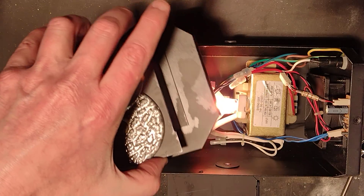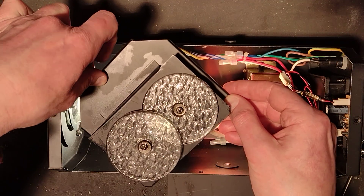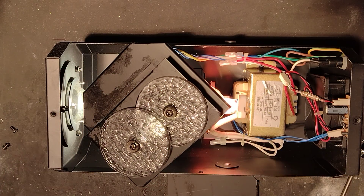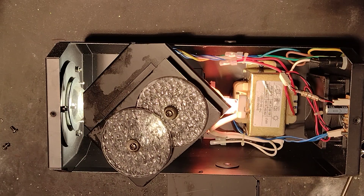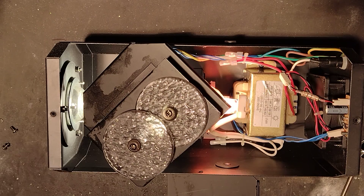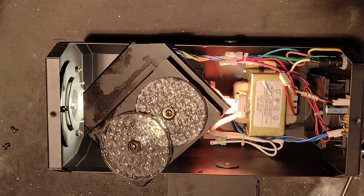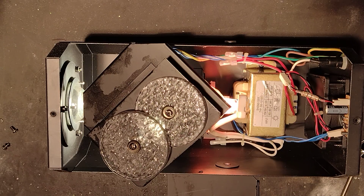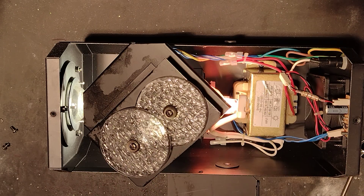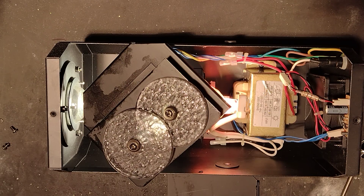It's a nice visual effect and it certainly works very well, but it's not a good way of doing it. There are better ones, particularly ones with the ability to focus, which means you can get a nice sharp effect or soften it on the wall. But fundamentally this is the basis of these ripple projectors — just two discs of glass with patterned glass on them. Look how off-center this one is — that's ridiculous, it's a very cheap and nasty unit. It's just two overlaid pieces of glass rotating slowly in front of each other, one going effectively down and one going up. The light interferes with each layer of glass and projects that nice rippling effect onto the wall. Good effect, shame about the quality of this light.